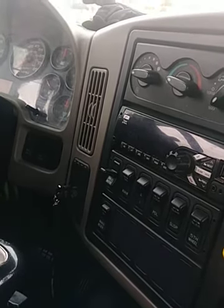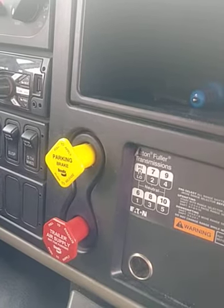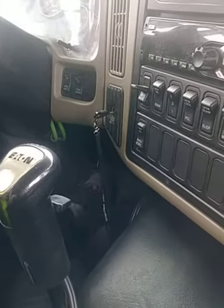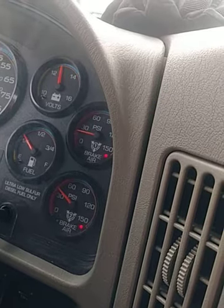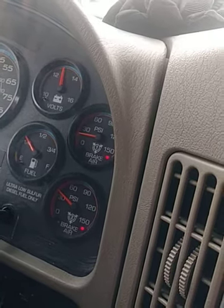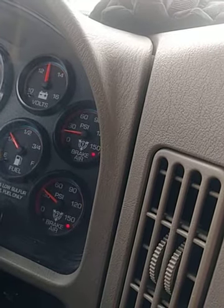For my next test is my emergency pop-out test. Purpose of this test is so my emergency pop-outs should pop out between 20 and 45 PSI. To perform this test I'll be fanning my brakes. Fan until you get to almost 30 and then slow down, because you don't want to go under 20 — that would be a failed test. Then the truck just stops.